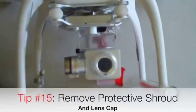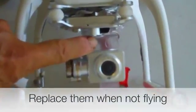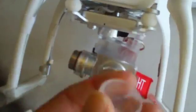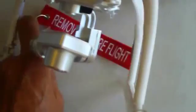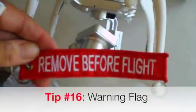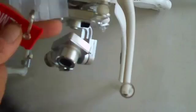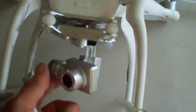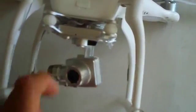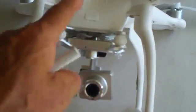Before you fly, remove the plastic safety cover that's protecting your camera. There's the plastic safety cover and the lens cap — pull the lens cap off, then slide the safety cover to the right to unlock and remove it. We have a 'remove before flight' flag on ours — you can order these on Amazon and hook it to your plastic safety cover as a reminder. You don't want this in place when you plug your battery in because when the camera gimbal initializes it's going to try to straighten out, and if the safety cover is on there, it's fighting against it.